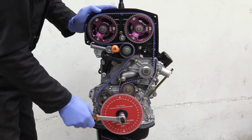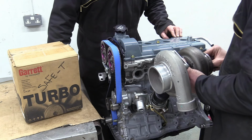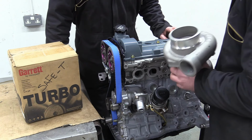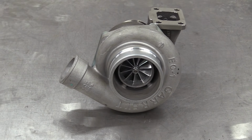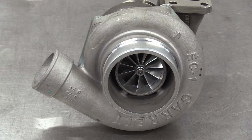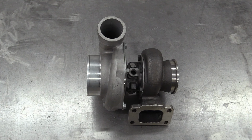At the end of the previous episode, we'd taken the old 3S GTE engine and completely stripped, modified, tuned and rebuilt it into something that should power the Mini to a respectable performance. Then I panicked and added some safety. The extra safety is being provided by this Garrett GTX 3582R turbocharger. It has a billet compressor wheel and a monstrous 4-inch inlet, along with a dual ball bearing oil and water cooled centre cartridge. This should give us all the safety we'll ever need.